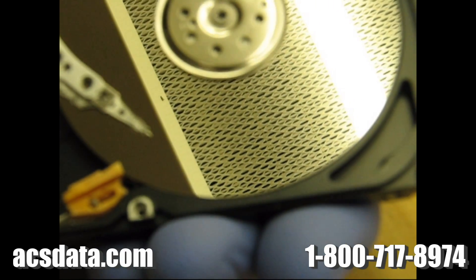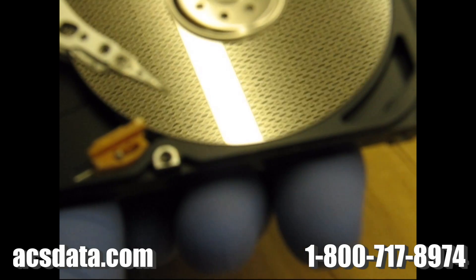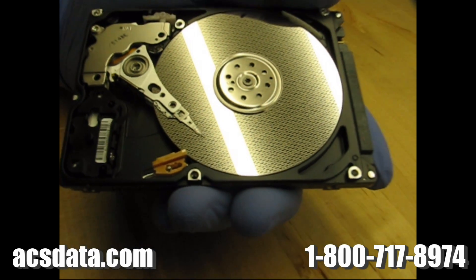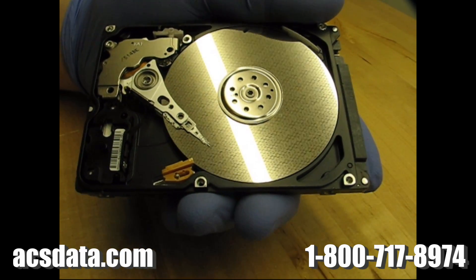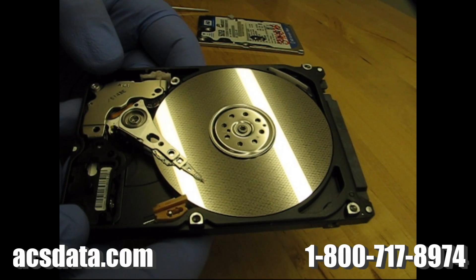You probably can't see it, but there are quite a few little specks of dirt on the platter already, and that's just with the drive being sealed. This drive hadn't been opened before — it certainly didn't come from the area that we're in right now, especially not immediately upon opening the drive. A lot of times you get drives in here and they're already dirty inside. Hitachis are really bad about it — it looks like they just put them together in somebody's living room sometimes. But beyond that, we still try to keep the drives as clean as possible. Any type of dirt contamination can be detrimental.